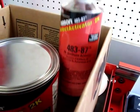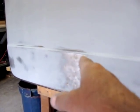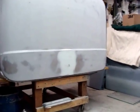What I'm gonna do real quick is go ahead and spread some mud on this thing, let it set, and go from there. Like I said, it's my first time doing any of this. I'm just watching videos and reading up as I go — if anybody sees I'm doing anything wrong, just let me know. I started out with 80 grit all the way around. I'm gonna go ahead and put some mud on that, probably scuff it up a little bit with 50 here and there to give it a good grip, then go from there.